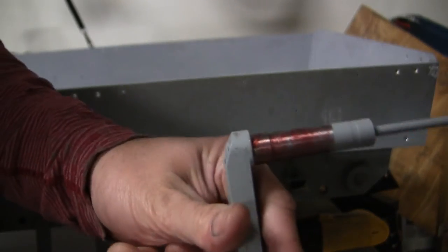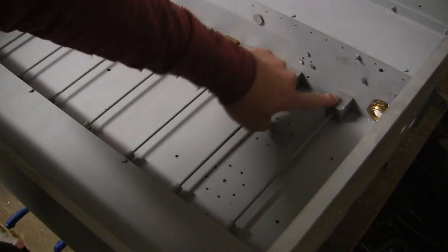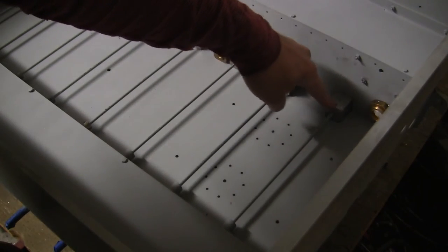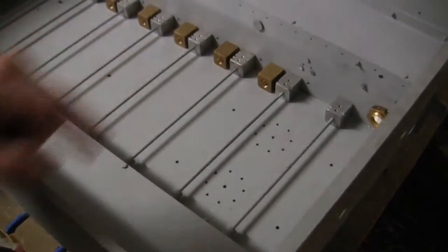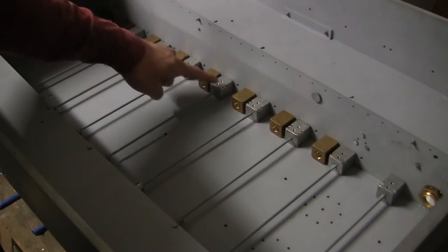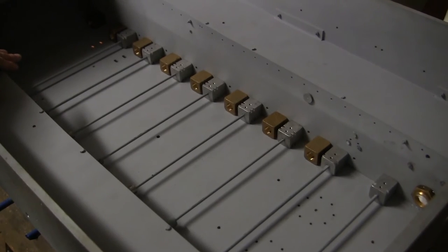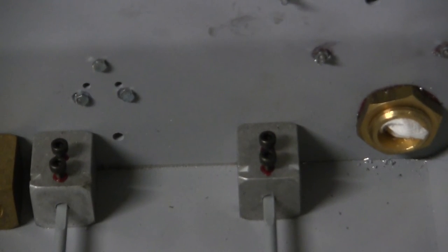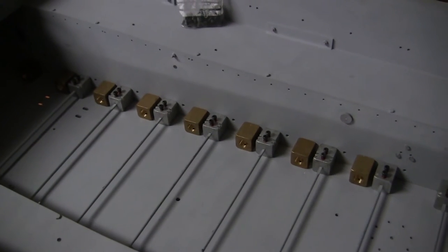A nice even amount of grease is applied to all of the surface areas of the bare metal. With the piece now lubricated, it then gets inserted into its location. As you can see, the torsion bar was a very nice simple install — this was due to the other modifications mentioned in this video, namely the widening of the holes as well as the alignment of all the blocks during their installation. Now, as you can see, all of the torsion bars on one whole side of the tank have been fitted to the vehicle. What is next is to go ahead and add the fasteners to these locations, which will keep them in their place, thus completing one whole side of the tank suspension.